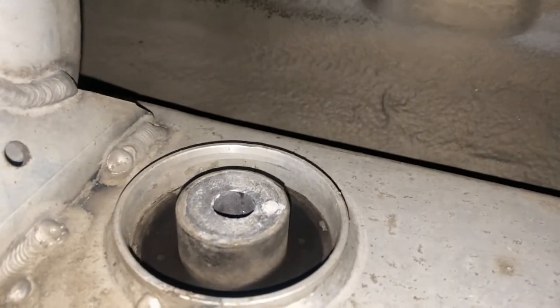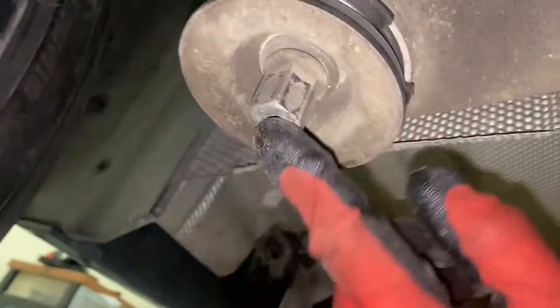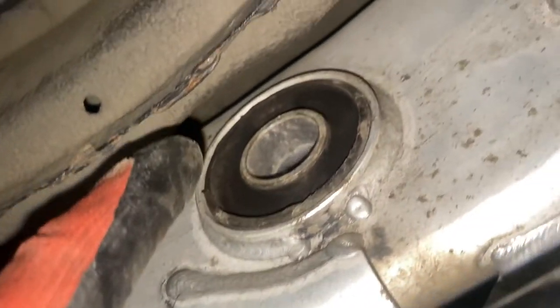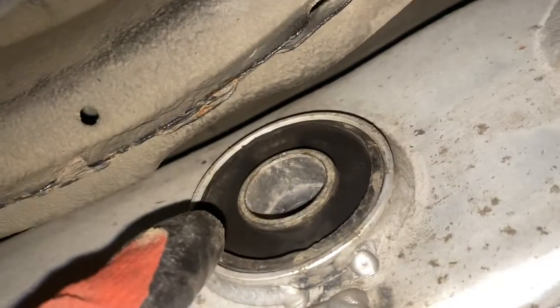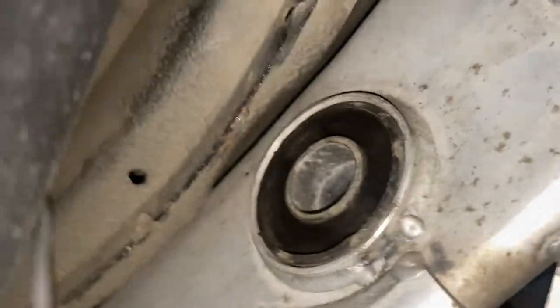I think though, before doing so, I was watching a video from E39 Source. I'll link that in the description below because it was very helpful. They actually removed these entirely, so I think I might end up doing that. These are loosened, the front subframe bolts, so I think I'll just remove these entirely. The problem is this is in the way, so I really can't get anything on this side of the bushing to push it out. So if I remove those two bolts, the entire subframe will drop just a little bit, and I'll be in a way better position to remove these.